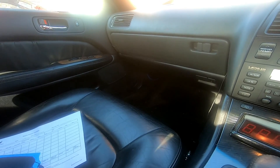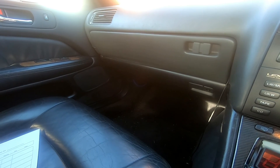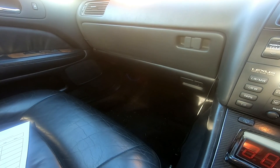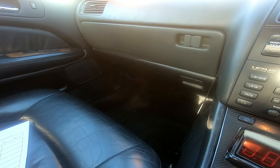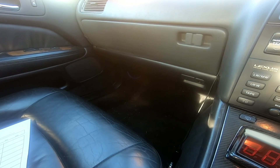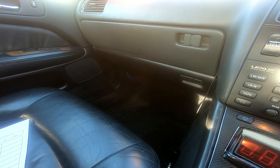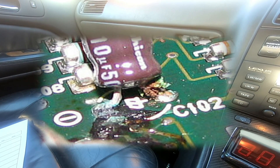What I'm going to do next - I want to pull out the ECU and have a good look at it inside, see what the situation is in there. Because this is an old car - looking at 23, 24 years old. And there is a common problem with ECUs in this age of Toyota, Lexus, in that the capacitors leak and cause all sorts of weird problems.